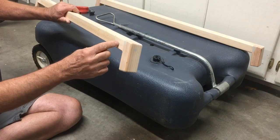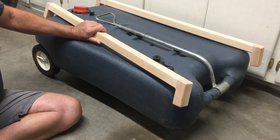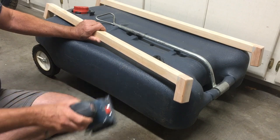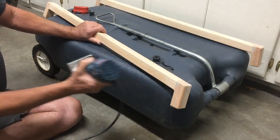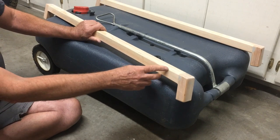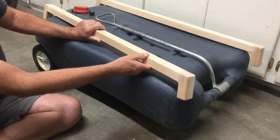When I did this I cut it and glued it with ultimate wood glue for interior or exterior. I shot a couple nails in here to hold it, then drilled the hole and ran a screw through into here and then puttied over the hole. So the screw actually goes way in - it's nice and strong. I sanded it with my sander, got everything sanded up, and took my router and routed all the edges so they're all smooth.